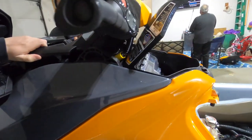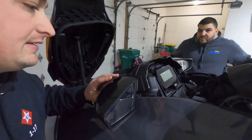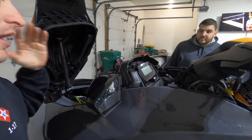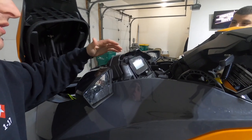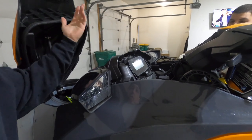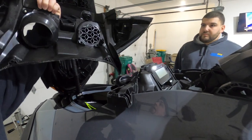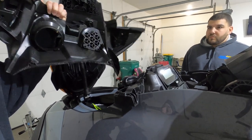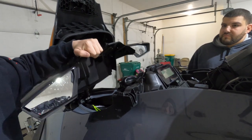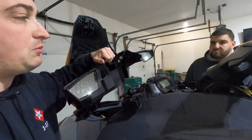We disconnected this already — I'm just putting it back to reiterate it for you guys. Per everything with body clips, the first time you do it it's going to be super tight. This one was just a straight pull and she came loose. Nothing broke. It was hung in on both sides by the mirror, so pretty simple. We can put this to the side and reinstall later.